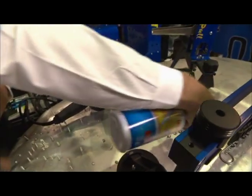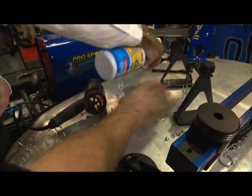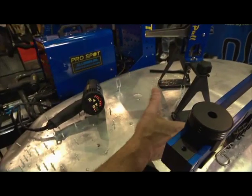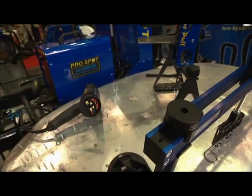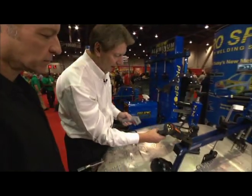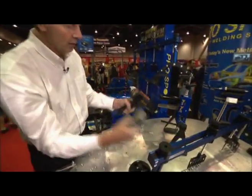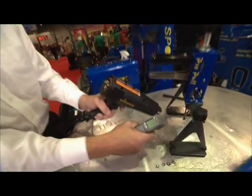So you're not really trying to prevent warpage at this point — you're trying to keep the heat in this work area so it doesn't dissipate out too quickly and you can keep that area warm enough to work the aluminum. Correct. And as we start heating this, we're using a laser gun, because aluminum doesn't change color as we heat it, like steel does.